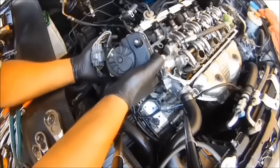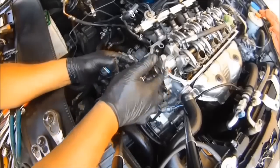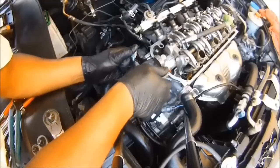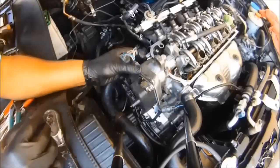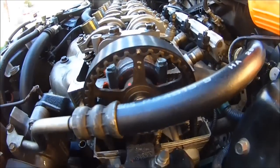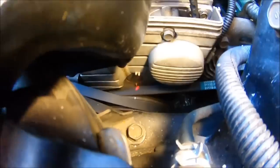This is right at number one cylinder — the deal goes like that and there's a notch in there to where this fits in perfectly. Get that right there in the notch. Get your mark lined up where you marked it at the beginning and it's good to go right there. Right now this rotor is pointed at the number one spark plug wire. The mark on the crankshaft pulley is right on the money — the 'up' indentation is at 12 o'clock position.